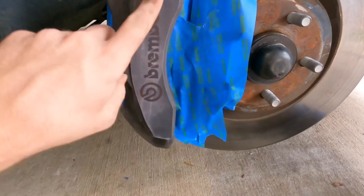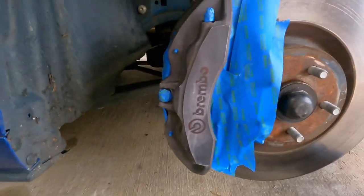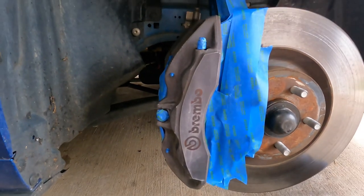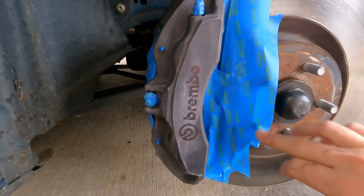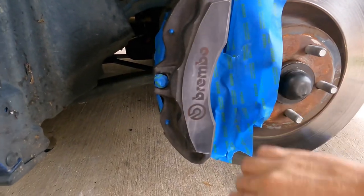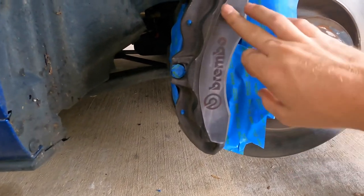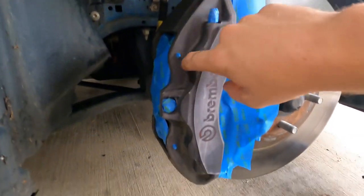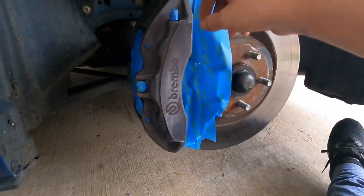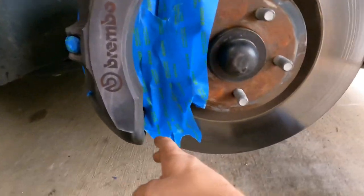On this front one — I've done a bunch of Mustangs — I know this in particular, the red Brembo is painted on, it's not a sticker. That reminds me, I didn't order the vinyl stickers to put back on, so I'll explain how to do that when we get to it. But you want to sand all of that off the best you can — just get rid of the color and scuff it up enough so the paint sticks. Make sure you get down into all the cracks. Anywhere big, you're going to want the paint to stick, so it needs to be scuffed.